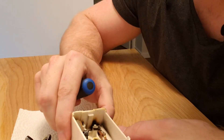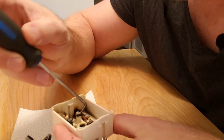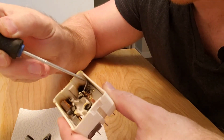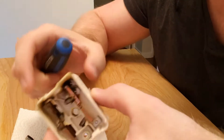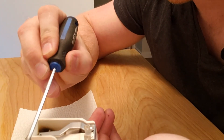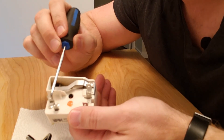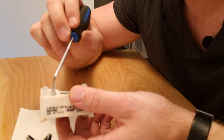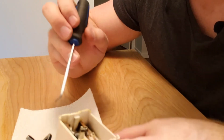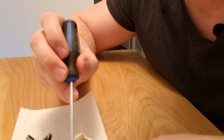What I noticed first off is there's a lot of burning up in there. So, this thing got really hot — maybe it arced out. Something definitely went on there, and that connection welded itself together. If we look on the other side, this contact here is the P contact. It is what sends power to that cooktop on light.